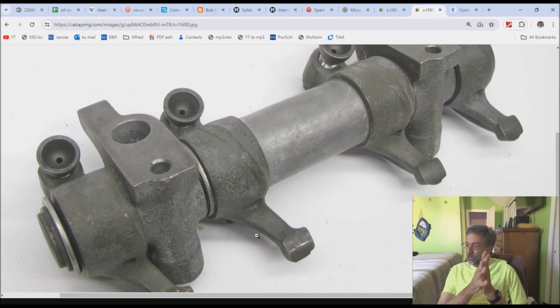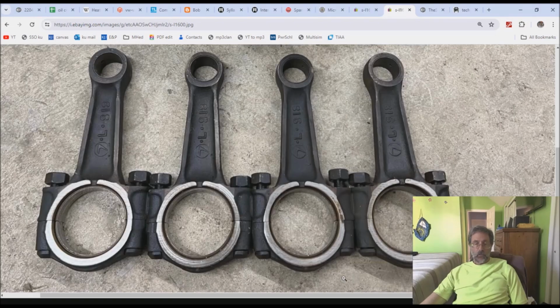So will it take heat out? Sure. Is it going to take a lot out? I have no idea. But in theory, yeah, you can pull a little bit of heat out from your exhaust valve and the exhaust guide and maybe get a little bit extra durability. Maybe. Let's move on to the next one. Well, next up on the list of cooling items then, since we took a look at the exhaust valve, will be the piston.